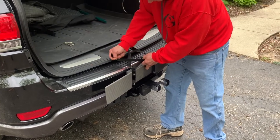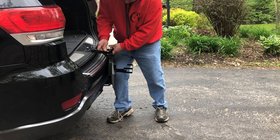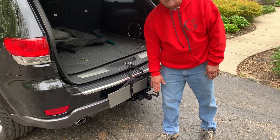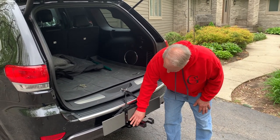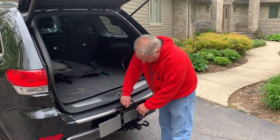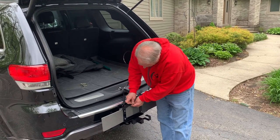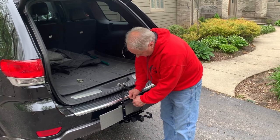Make that final adjustment, pulling them tight so that it'll be suspended in the center. A distance that we like to have is anywhere from 14 inches on the low side to 21 inches on the high side. Once we determine that it's a nice fit and it's in the center of the bumper, we will take our zip ties and pull the straps the opposite direction once we've decided where we want them. We're going to use our zip ties just to make sure that those cannot come loose. Once we get it in place and we like it at this height, snug the zip ties up.